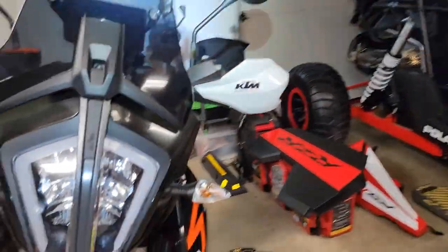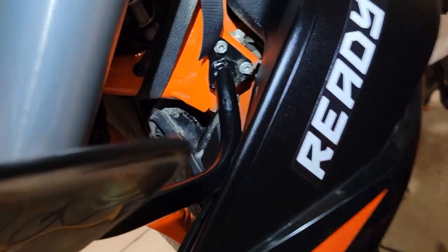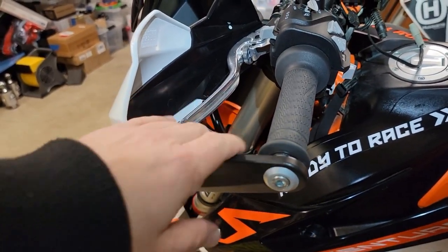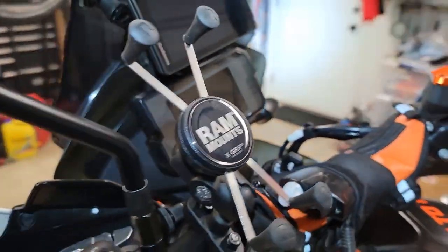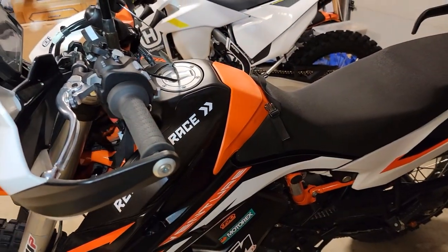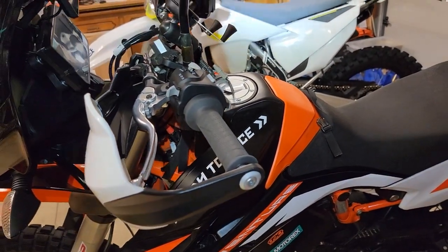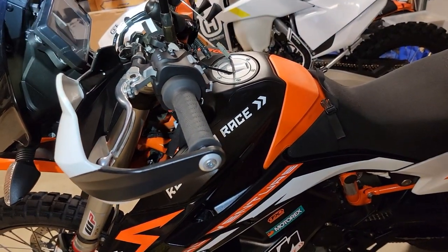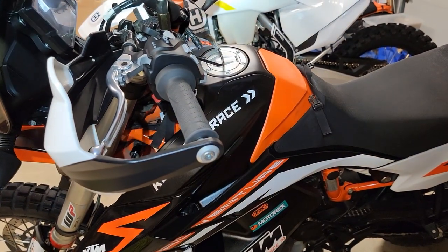It appears I found the factory connector for the heated grips right here. I haven't removed the tank — they're uninstalled — so I could be wrong, but it appears the connector is right here, stubbed off. I won't get too excited, but it looks like I'm just going to plug in there. I'll remove my seat, remove the crash guards and factory grips, plug in the relay, and activate them from the dash. I've been waiting a couple months for these — riding in 30 to 50 degree weather in Oregon — I love heated grips.